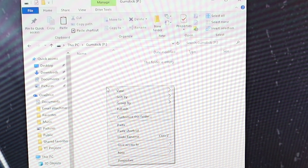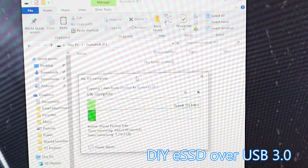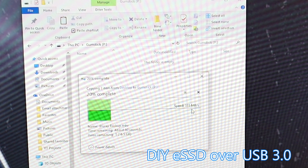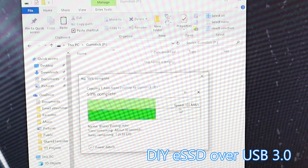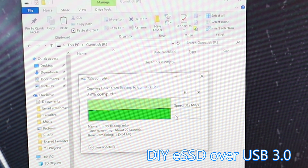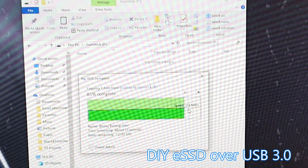I've just freshly formatted this and I'm going to do a quick copy test of a Blu-ray backup and see how fast this thing goes. It looks like we're topping out at about 320 megabytes a second, which is not bad at all. I do expect that the speed will fall before too long, because the 660p is going to run out of SLC cache. The fuller this drive gets, the slower it will become. But 323 megabytes a second is not bad at all — that's pretty competitive with my T3 one terabyte.